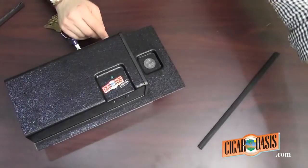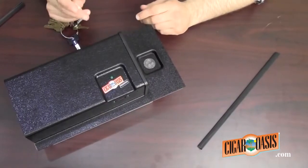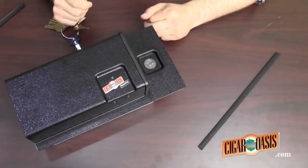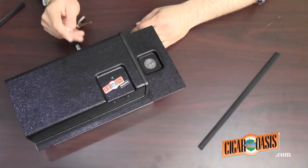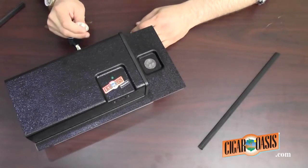If it goes to the very top, water can splash up into the control top and get onto the sensor, and you'll get an H2O reading — which doesn't only mean low water, but also high amount of water. That would mean you need to dry out the control top, which can take some time and is not guaranteed to work.